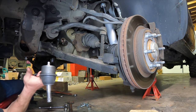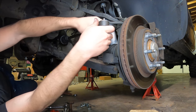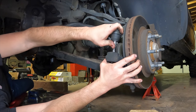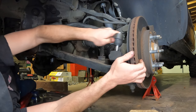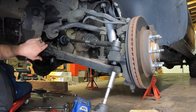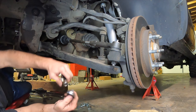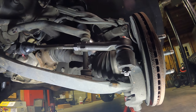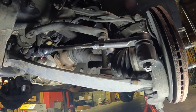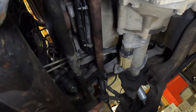All right boys, we're on the final stretch of this install — thank goodness. Take your little cap off, work our tie rod in. I'm going to use the impact very briefly just to get this started, but not go all the way tight — then we'll tighten it down by hand. Make sure to throw your four cotter pins in. I saw you all in the last video calling them something different — whatever, cotter pins. Make sure you throw those in there so those bolts have no possibility of backing out.